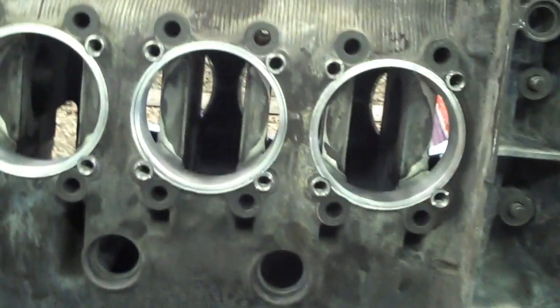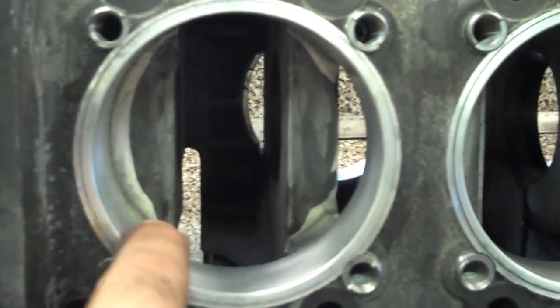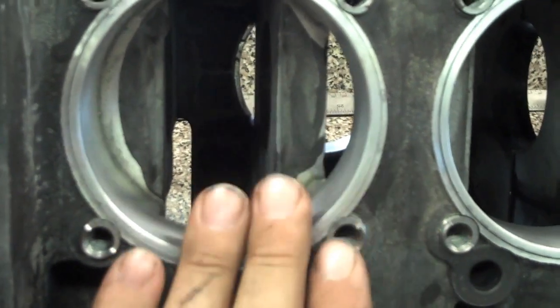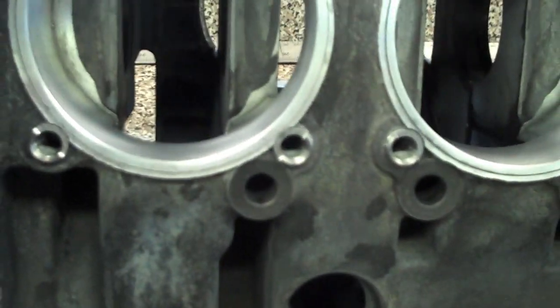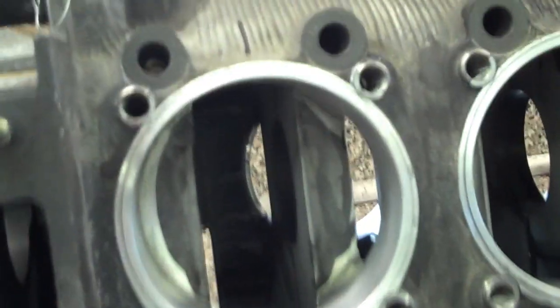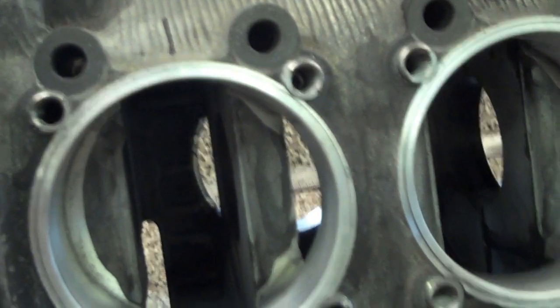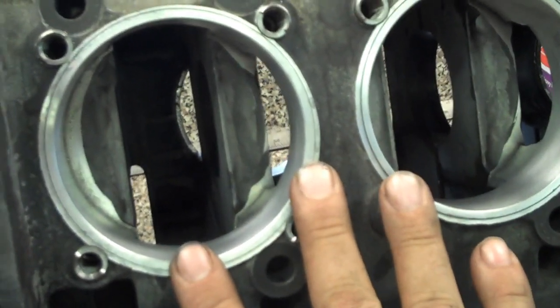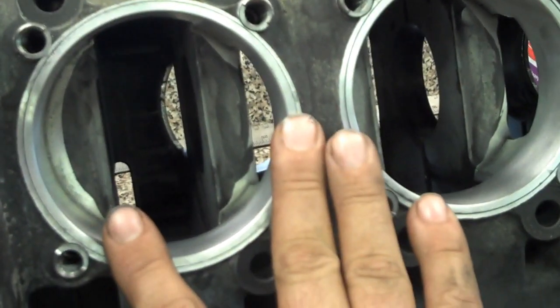We have a factory S case. It's been sleeved. The sleeving is sometimes needed when we get a case that's been damaged in here, corrosion on the magnesium, or maybe it was opened, or something was changed that the standard 2.4 bore cylinder doesn't fit. So actually what we do, we machine the block itself. We have a special insert that goes inside.